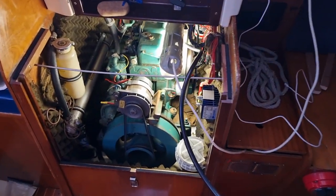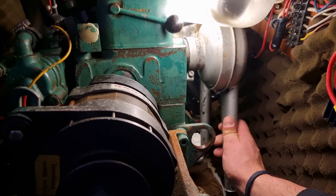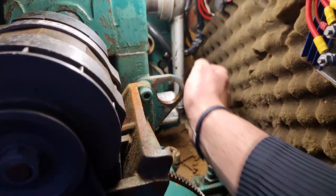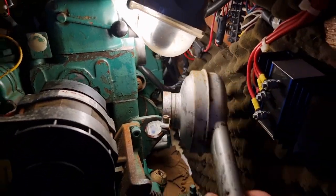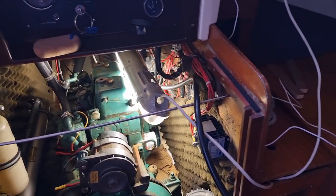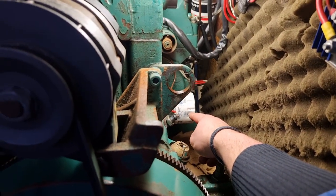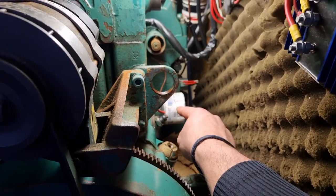Now we're going to unscrew the filters. I already did that so I'll take them off. The last filter is connected to a hose — I already took the hose out, but the hose hole is here in the back with the hose pointing up. When these two are out, you have some space to twist the oil filter out. First suck out all the old oil — 2.2 liters — and then get the oil filter out as well.